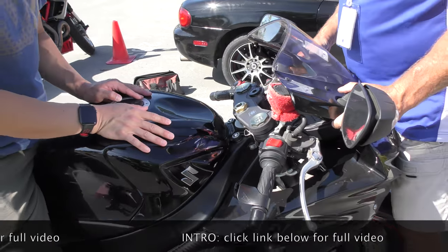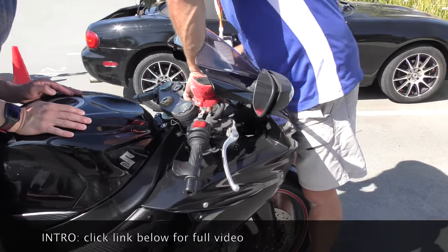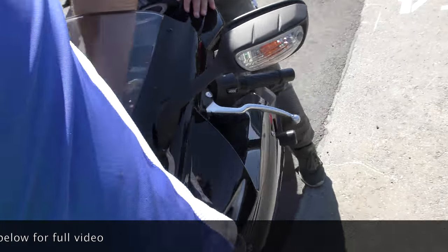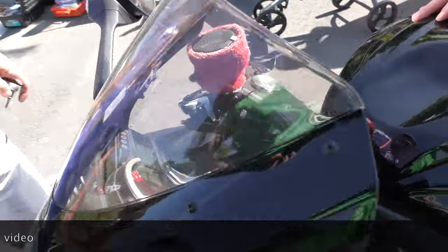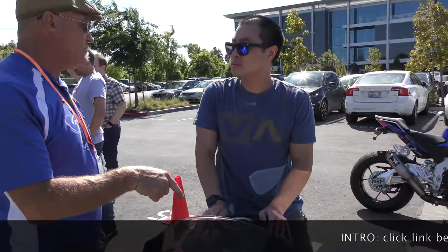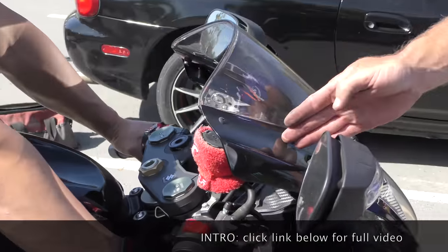It's way off. So one of the problems we run up against is something called clocking. If you look at your brake line, there's only a certain amount of room here. You cannot have the brake line touch the fork down there. If you do, you get harmonics which gets resonance. The brake line is harder and it will eat into the fork. Whenever we put brake lines on, we always set them at 12 o'clock.